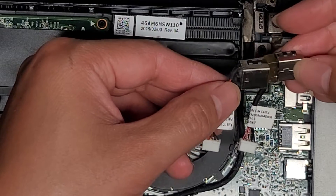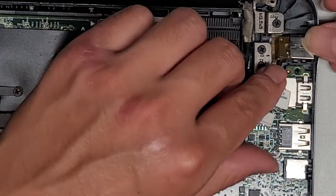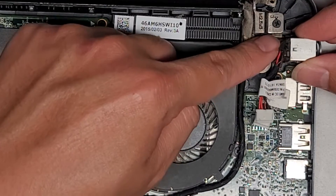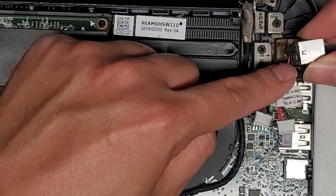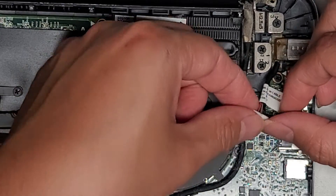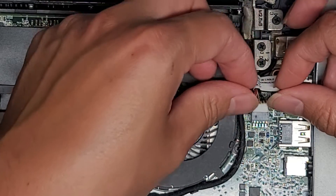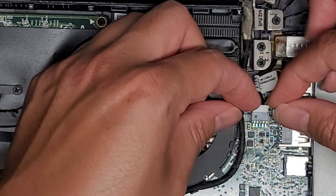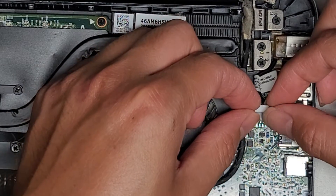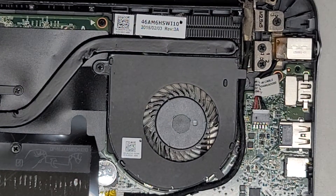This charge port looks a little bit different — hopefully it will fit okay. Looks like it fits okay. Drops in there like that. You can see they actually put some coating stuff over this so it's a little bit more sturdy. Same thing on reinstallation — you want the red wires going towards the fan and the black ones going towards the outside. Just line that up and make sure you put the connector in straight. If you put it at an angle, you could bend the pins. And there we go, we got that in.